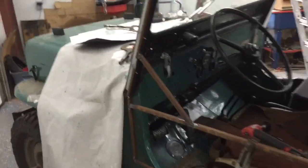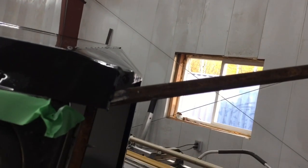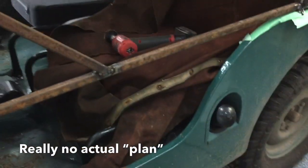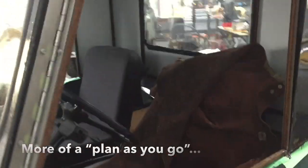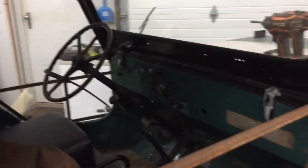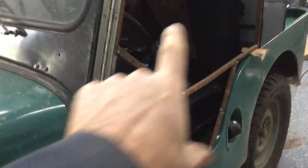Next I start on the doors. I'm trying to make them super simple — I just took a piano hinge and mounted it right to the windshield frame so it swings, then boxing it in. The door opens up a little bit which should help it stay closed. My plan is to skin it by pop riveting on aluminum just like everything else, and then put a large window of some sort in it. You can kind of see the door frame — I'm getting ready to put a little skin on the upper portion, and may try to fit some plexiglass in it.